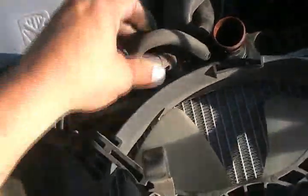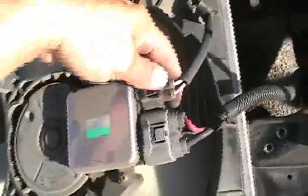If your car is an automatic, you're gonna have these transmission lines that you need to remove. You need to remove these lines. Also, you need to disconnect the fans. It's only this one that you gotta disconnect. You push on this button here. You push and hold, and it'll come off like that. You only need to disconnect this one. That's all. And then now, for me, all I gotta do is remove the transmission lines, and I'm ready to go. And the radiator's off.